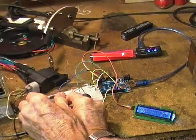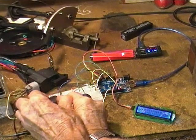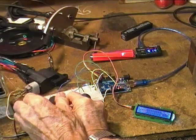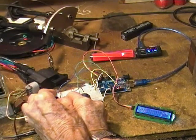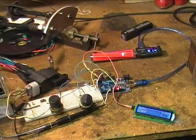Here I simply run the speed pot through its full range, just so you can see how the LCD responds and the little LED flashes. This is a non-linear pot so it goes up pretty fast toward the end. I suppose it's from some audio source.